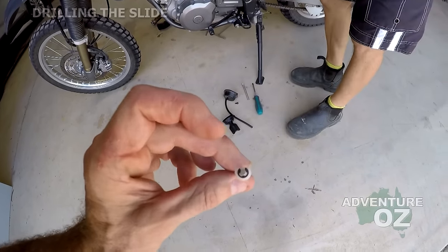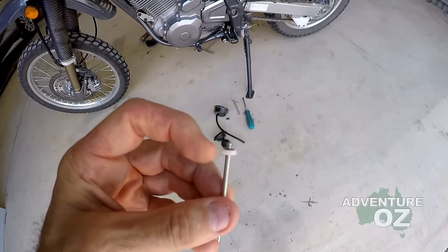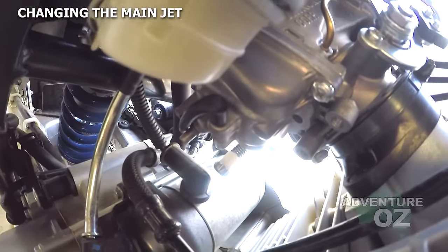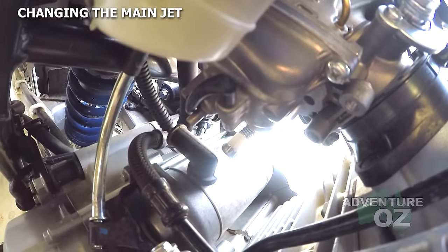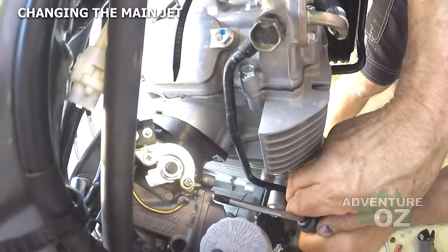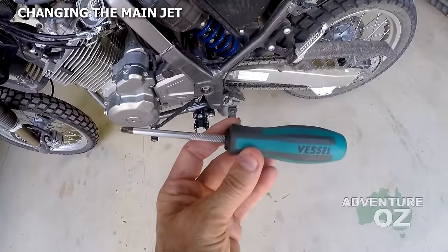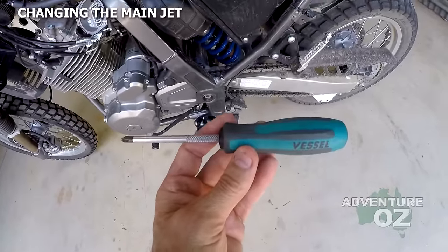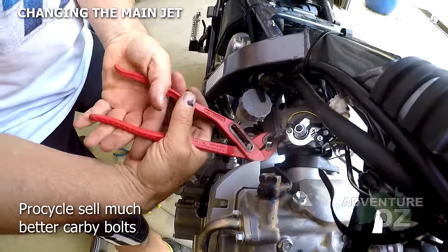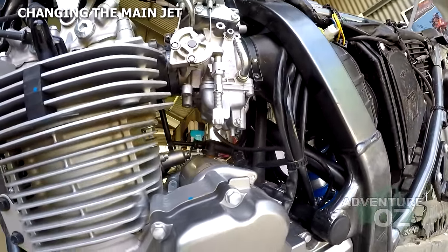Because we've shaved that bit of plastic and it'll sit further down, we don't need to make any adjustment of the needle position — for Australian conditions year-round this is a good compromise. Suzuki put these terrible Phillips bolts on the float bowl and they strip very easily. An important thing: these bolts are not actually Phillips — they are JIS, Japanese Industrial Standard, and this is a JIS screwdriver.